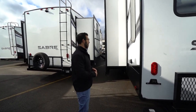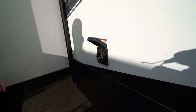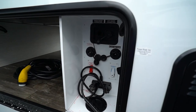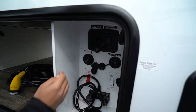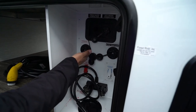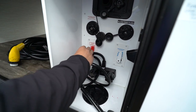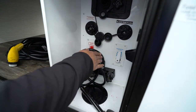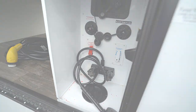Having the backup camera prep makes it easier to install, saving you money on labor. The last thing on the back end is your 50 amp detachable power cord, which plugs in right there. Taking a look at the convenience center on the off-door side, you will see all of your water hookups for both your fresh tank fill and the city fill. I really love that it's easy winterization — you can hook up your antifreeze right here to pump all the glycol through, and your water heater bypass is right below it. You can see the winterization system, black tank flush, outside shower, and also your cable and satellite hookups.